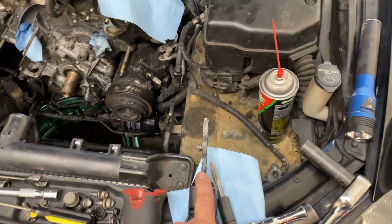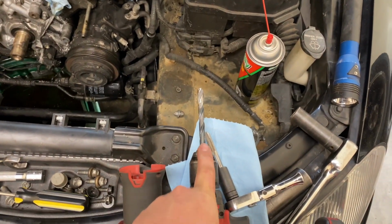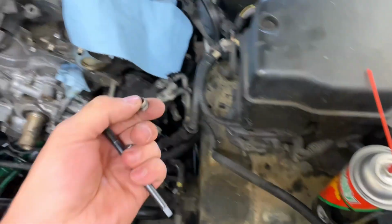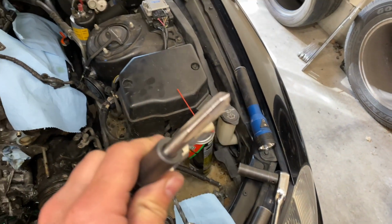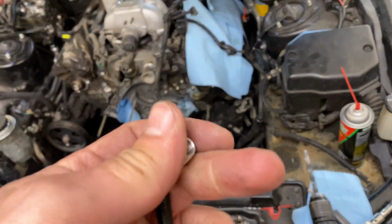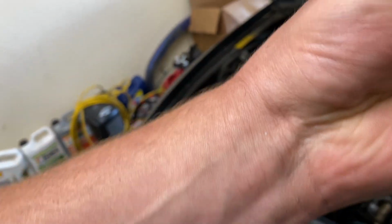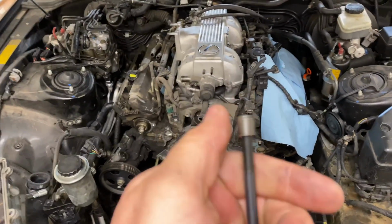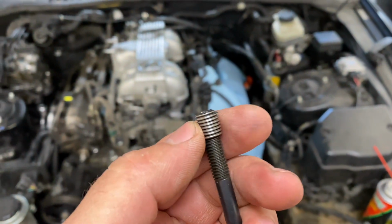All right, so thankfully in my tap and die kit, I had the right size drill bit. It's a 21/64. So got it drilled out. As predicted, the little guide dowel came out of the hole. But used their tap and ran that through a few times until it goes in and out pretty smoothly. And now this is the installation tool. So you'll see it's threaded. It has kind of a notch on the end. So that way, when you spin your helicoil onto it, that notch on the end catches the helicoil, and that's how you drive the threads in.